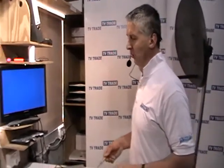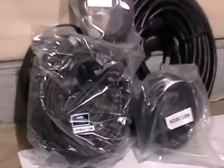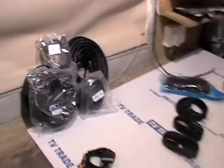We do stock a wide range of alternative ways of connecting a box. Increasingly, HDMIs are popular, and we stock HDMI leads from about 1.5 meter all the way up to 20 meter. The industry is basically moving from a 1.3 standard, which is just typical, to a 1.4 standard, which is sufficient for 3D and things like this. Some people like to future-proof themselves.